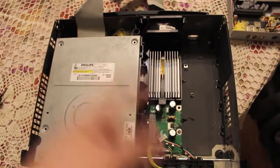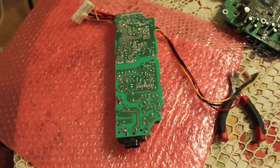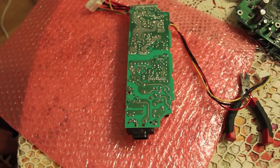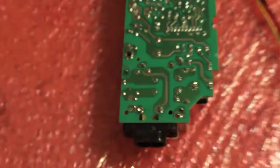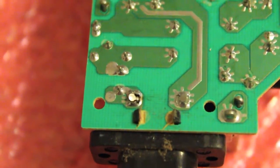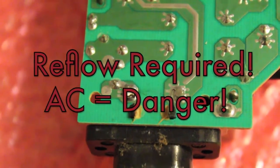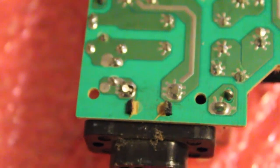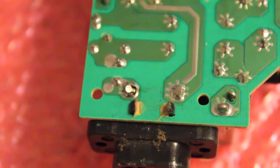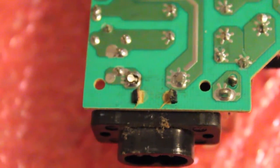But right now we're going to repair the power supply and we'll just show you the damage that that has. Here we are with the power supply out of the Xbox I've been working on. We've discovered there's a very strange buzzing noise coming from it, and we've had a bit of a closer inspection and discovered a dry joint — a cracked joint on the AC in, which is pretty important. The buzzing noise we were hearing was probably the arcing of that to the actual board. So we're going to give that a bit of a solder and get back to it.